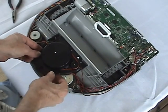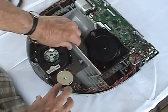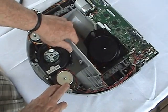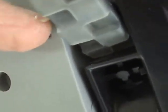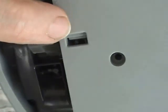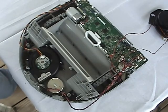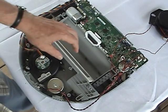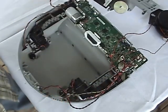With the screws removed, we can get the LiDAR out of the way. You'll see there's an assembly down here that has to be snapped loose to free the drive wheels for access. There's a plastic tab right here that has to be pressed to release the assembly that holds the drive wheels in place. Once those locking tabs have been released, you can move this basic assembly that hides the drive motors away to gain access to them.